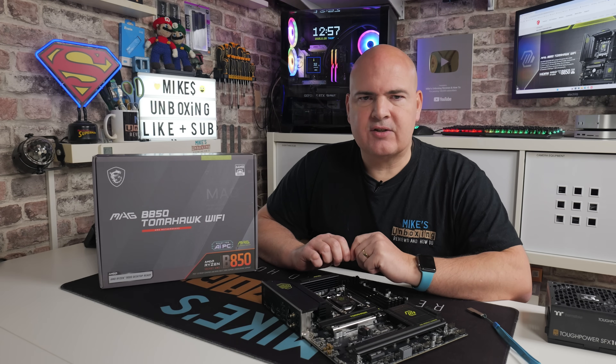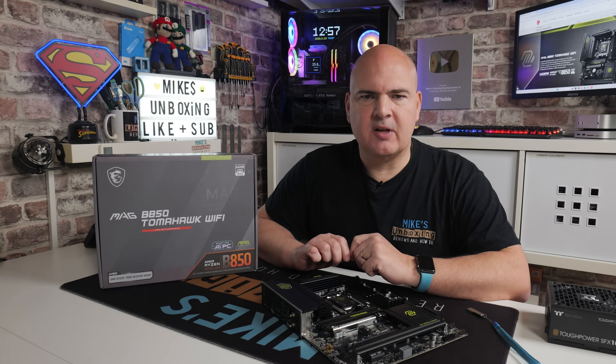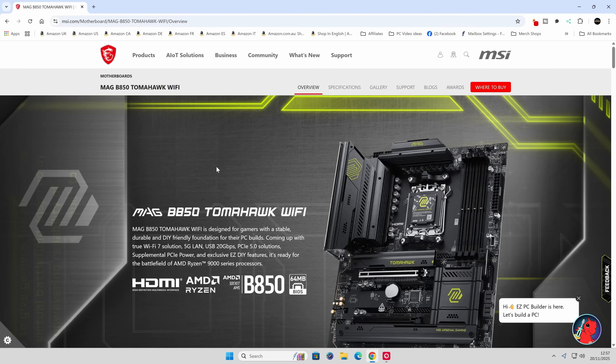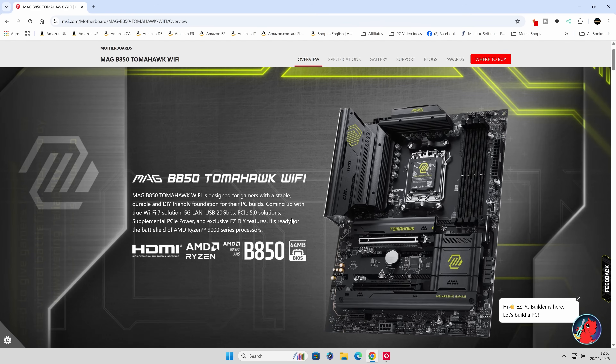So there's the intro and some basic troubleshooting tips. Now we're ready to go over to the computer and get the BIOS and prepare our drive. So we're on the MSI website — links will be in the video description. Make sure it is the right board: not the Tomahawk Max Wi-Fi or any other variants. Make sure you have the specific one that you have and do a visual check — same part numbers, etc.